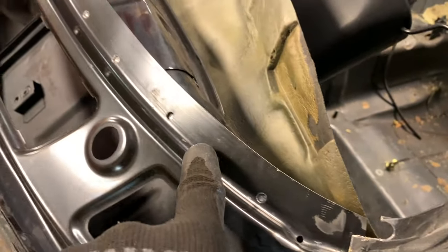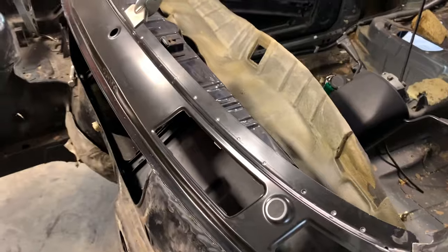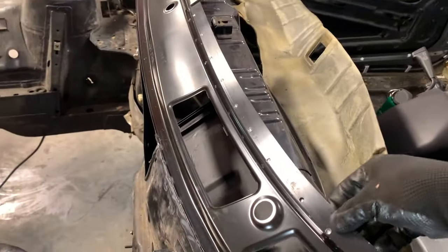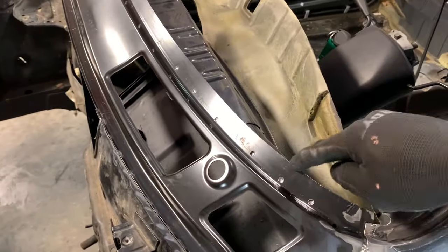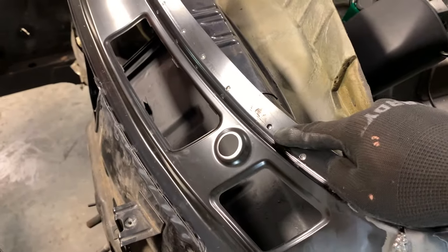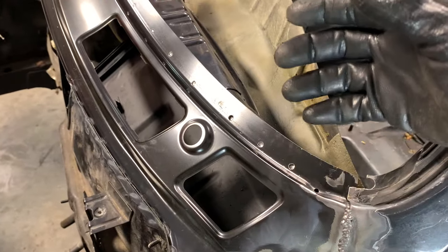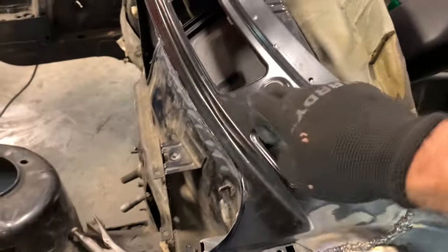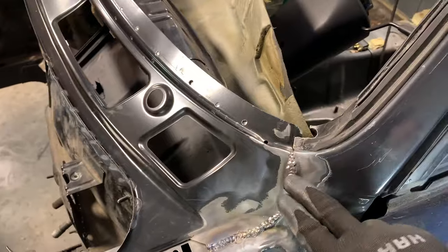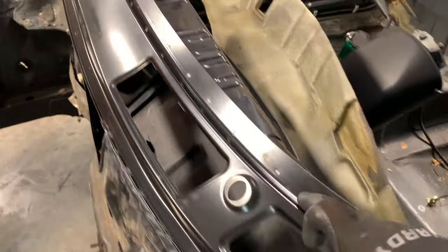And then I started drilling holes into these two panels. Now, as you saw, maybe not directly, but I did drill only through the first one and not through the second one. And that allows me to make a really nice spot weld right into the hole. And it's a good clean piece of metal that I can weld right into and not have splatter. This coating, I needed to obviously grind away in order to get a good weld. But yeah, that's what I'm doing here.